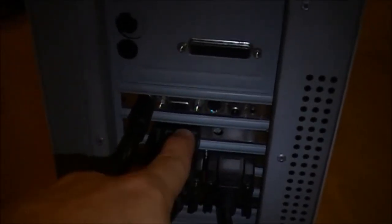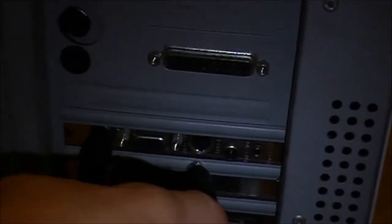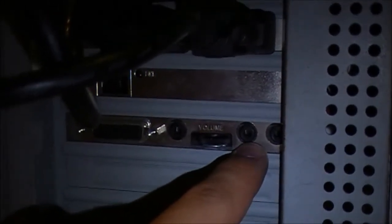As far as the screen connection is concerned, here is how it works. The video card is actually connected through the Voodoo video card. The Voodoo card is then connected to the Realmagic card, and you connect your monitor right here. On the Realmagic card you have something to plug it into a TV if you want, the SPDIF audio out and a stereo audio 3.5mm jack. And there is a standard video card, the Voodoo card. As for the audio card, there is a game port on it. This is for speakers. There is a real volume knob on it. This is line input and microphone input.